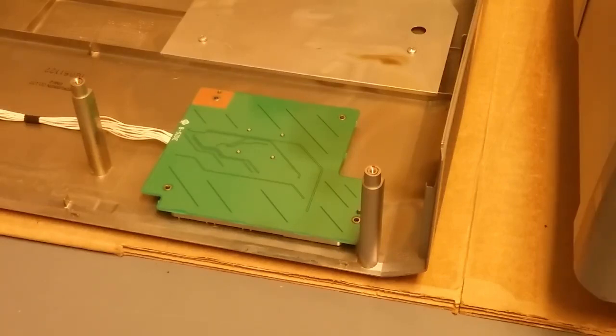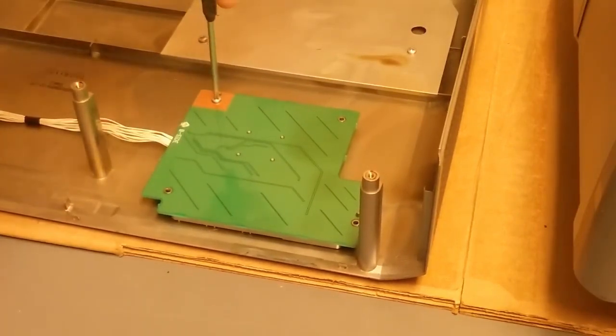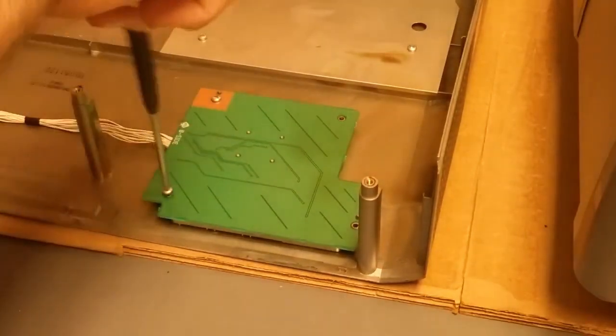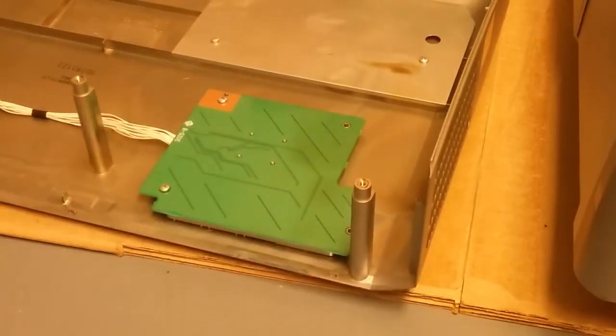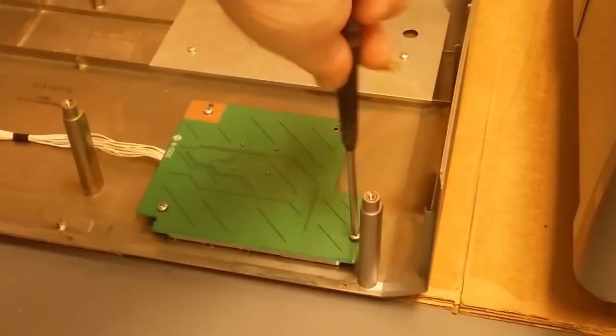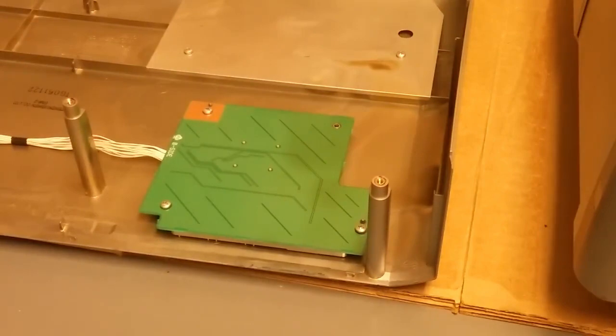There's the optic section. This is the LCD panel. There's our green. I think that's blue. Yeah, and there's red. Now these, make sure I'm looking at this right. I believe it's this one right here. These are the polarizers. We can swing those side to side, and that will change the color purity. But we're going to see if it's a dirt issue first.